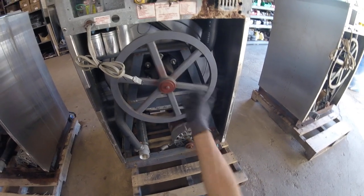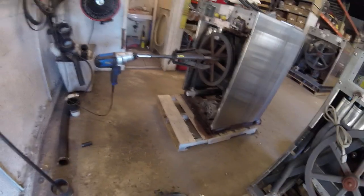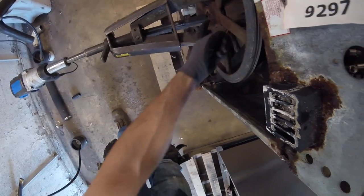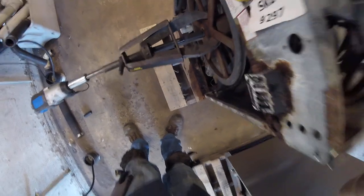In that case, I usually remove it and then tap it for half-thirteen and put a regular one back in. Take that out, then get your puller mounted in place. I like to put an impact-rated socket in line in between — I do not want the end of the puller going into the threads on the drum and messing all that up. I mean, if it does, you can still re-tap it and fix it, but why break it if you don't have to?